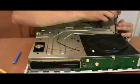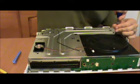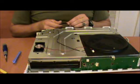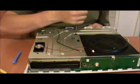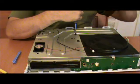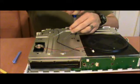And we've got 4 more. Now, once you actually get into this physically, when we actually open it up, you'll notice, if you haven't already, that the physical architecture, as far as the layout of where all the parts are inside of the system on the Xbox One, is nearly identical to the layout internally of the Xbox 360 Type S and Type E, because it goes optical drive, fan, hard drive. And then you've got your control board up front, your Wi-Fi board here,